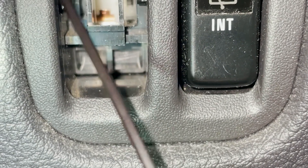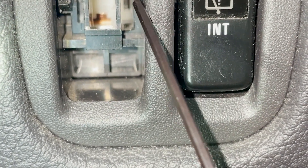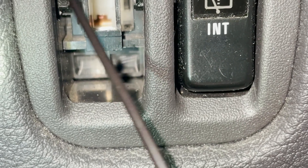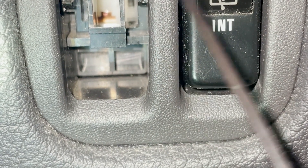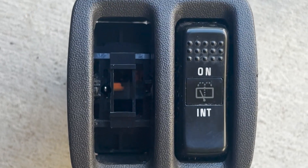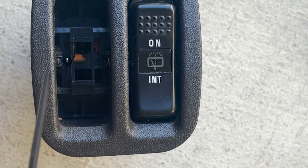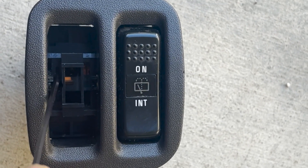I'm going to insert this side first because that's what I repaired, and then this side because that's solid and not broken. So most likely this should not break. The repaired side is maybe a little weak, so I'm inserting it first to avoid putting extra stress on it. Small correction: there is actually a spring here - it was just missing in my other switch. I'm going to lift up the steel ball and show you - that is the steel ball I was talking about, and I'm going to pull out the spring.